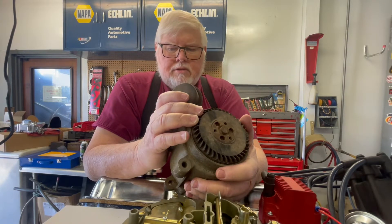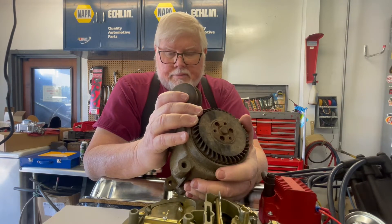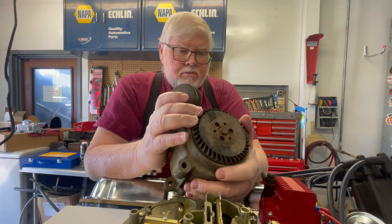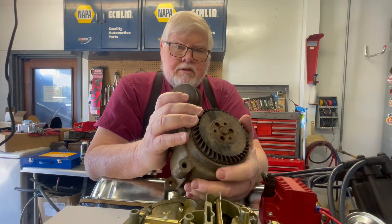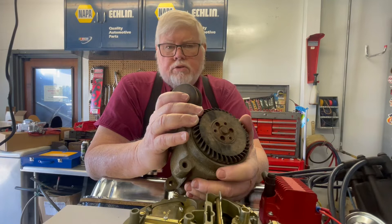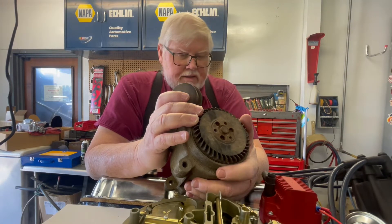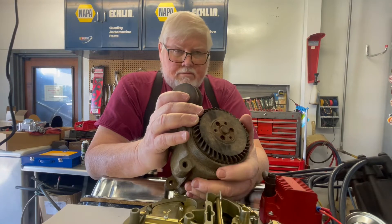The truth is, this is one of the most effective means of pollution control. In fact, in order to adjust carburetors like we did back in the day with the sun machines and everything, we'd have to block these off because it cleaned up the exhaust so much we had to pinch off the hose going to the engine. Otherwise we would get false readings.